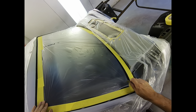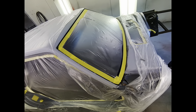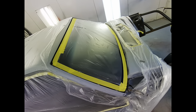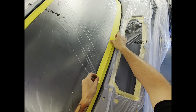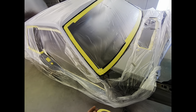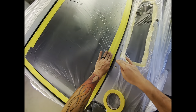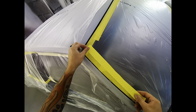You don't use paper anymore — that's kind of outdated. If you see somebody painting a race car using paper masking, you probably want to run. Drop plastic: it's way more efficient and you don't have to worry about the edges leaking onto the customer's car. Nothing wrong with paper, it's just outdated. If you're using paper, newspaper has tiny holes in it so paint can leak through. If you absolutely insist on paper, at least get masking paper from a roll — you can find it at Lowe's or Home Depot.